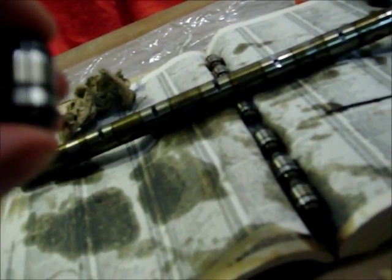So I had a clattering in the engine, and I already knew which lash adjuster was having the problem - I think it's this one right here. The top of this one has got little ding marks all over it. Now, this is a good one here - see the bottom is perfectly smooth and very slick, it doesn't really move when you squish on it, even though I've bled it. And the bad one moves quite a bit when you squish on it. So it's not inflating or deflating the way it should, or it's got too much play in it, and that's causing it to tap on the valve as it's going up and down, making that clattering sound.